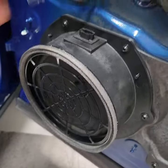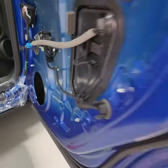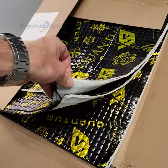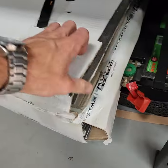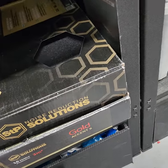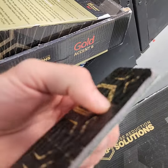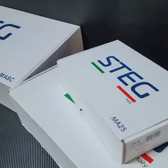The doors have been removed and the factory speakers will also get removed, as seen here in the back doors. The first thing is always to soundproof the whole door with different soundproofing layers — one layer here, and then a couple of different layers from other materials, such as soft material and non-water-absorbing material that goes in the door as a second layer. That second layer is from STP.